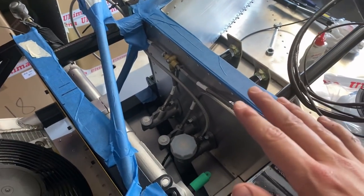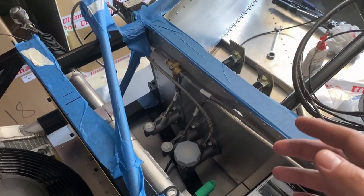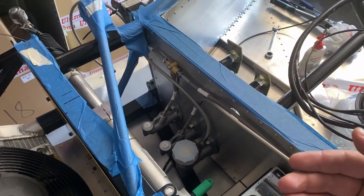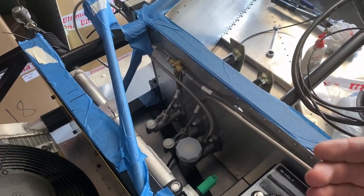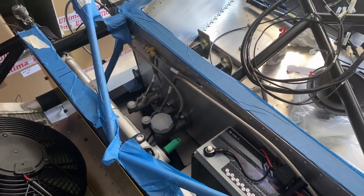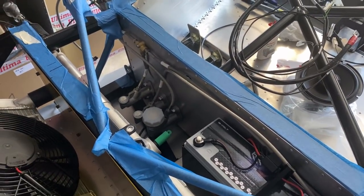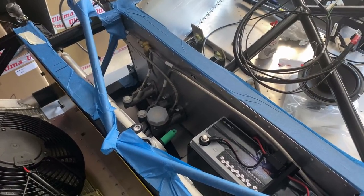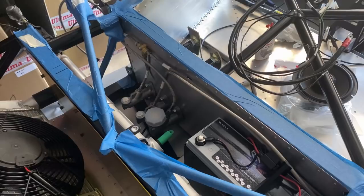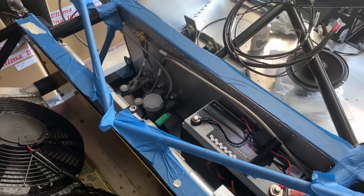This is more of a race car style setup, because you do aim to sort of muck around with this when you're at the circuit to optimize your braking. Ideally what you want is, in every situation, you want your fronts just to lock in advance of your rears, especially in a car like this. If you were driving along and you had too much rear bias, you'd lock the rears, and you'd find that you are in the fence pretty quickly. If you want an analogy to that, it's kind of like the handbrake turns you used to do in the Macca's car park in your mum's car when you were learning how to drive.